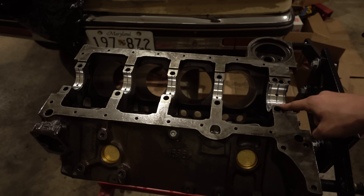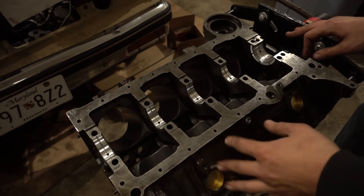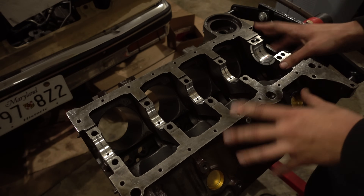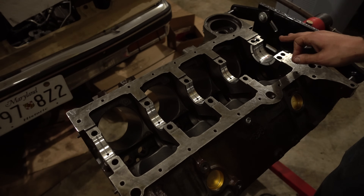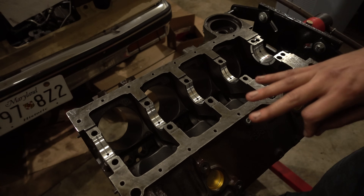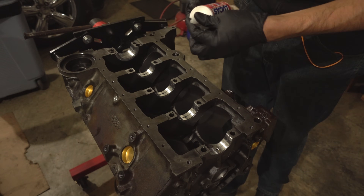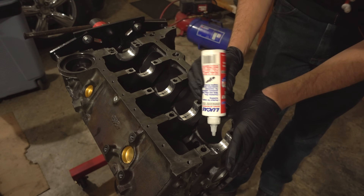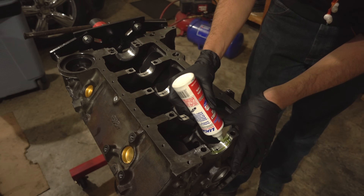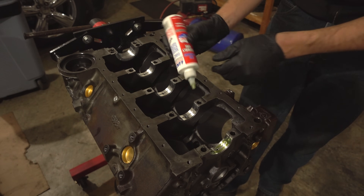As far as a real ideal build, you want 0.002 to 0.0025 for these, and a maximum of 0.003 for the rear main. It's definitely not ideal. I'm still not going to fix it — this is going back together like that. But we'll definitely check oil pressure while rotating the crank while we pre-lube it, because as clearances get high like this it can really start to affect oil pressure. Since I wasn't going to do anything about it either way, that was all academic, but I like knowing that everything is not insane. I'm using Lucas assembly lube, but any engine assembly lube is going to work — it's thick oil that sticks on there real good, and hopefully we'll be there until startup.